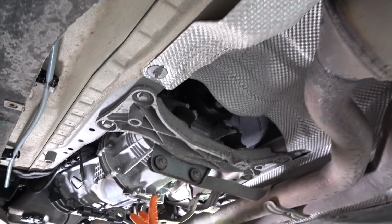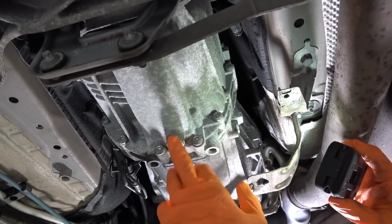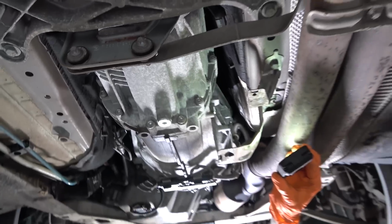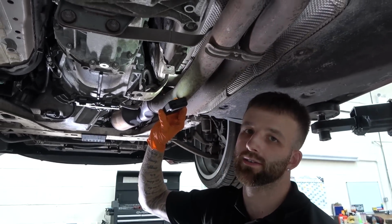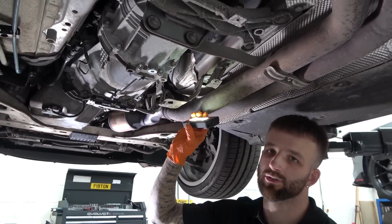And then as I was saying with the gearbox, the drain plug and the filler plug are fairly fresh. So that's been changed recently as well. Which normally is lifetime. It should be lifetime, that's what BMW quote, but obviously oil degrades over time, so it is worth changing. Normally around 90 to 100k, so that's probably why.